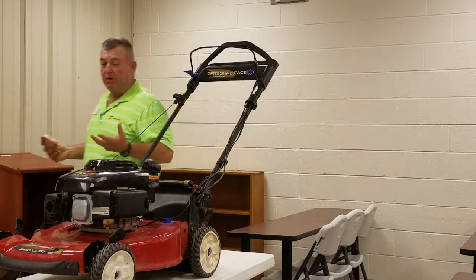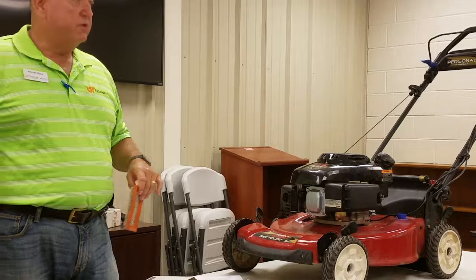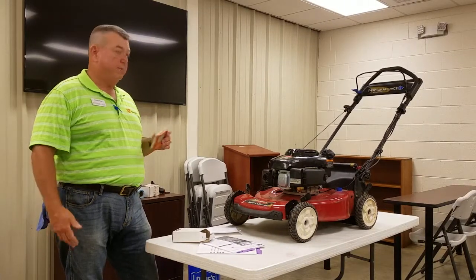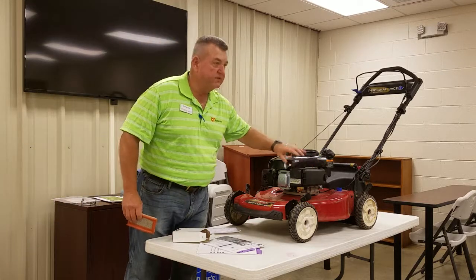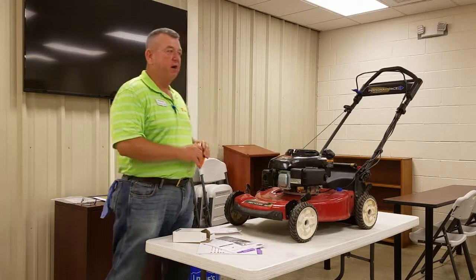So that's the air — you've got to make sure you get plenty of air by keeping a clean filter. The manual tells you how often you should check it. You can't check it too often. You just want to take it off probably every time you mow.